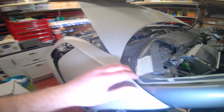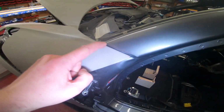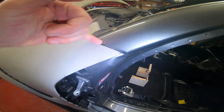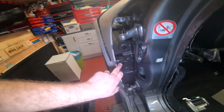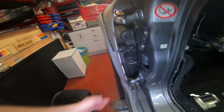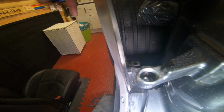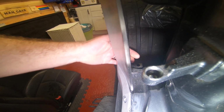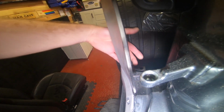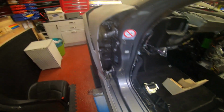It's a bit scary. But yeah, you can see you want to line up this part of the wing with the bottom of the Boxster. So there's a little gap there. You can see here I've attached the wings. I did that after the event, right? I basically secured it. In fact, look here, you can see how I've secured it at the bottom. It's just two screws that screw in. It's bonded as well when I'm finally happy with it. But it's screwed in there into the Boxster metal and also this side panel, right?